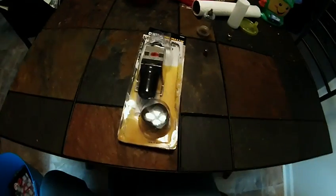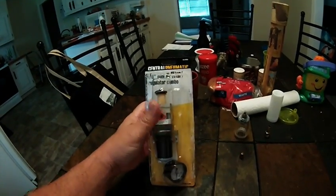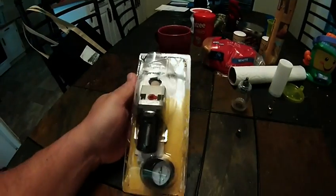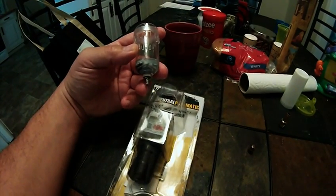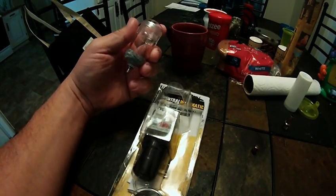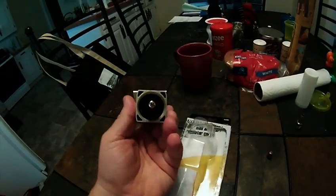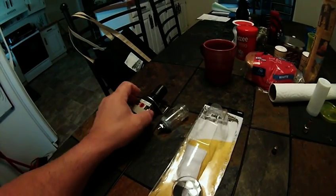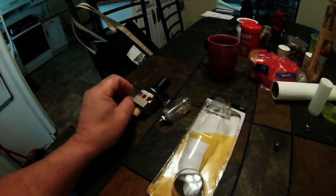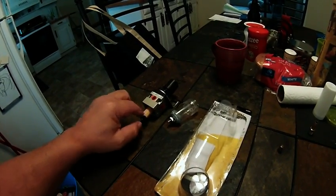Now here's another aspect of the battle of the blow-by. I've gotten one of these central pneumatic mini air filters for an air compressor — got it at the China Mart. It comes with a little gauge, which I'm not going to use. It has a little cup that screws on the bottom with a little valve: when the air pressure drops below a certain amount, that valve opens and drizzles the water out, because it's primarily designed to separate water. There are little angled vanes inside that create a vortex, so all the water settles on the side. When it goes from high pressure to a lower pressure, the larger volume lowers the pressure, and the water drops out of suspension. Then the air goes through this little brass cloth and back out the other side.